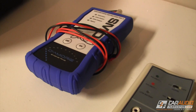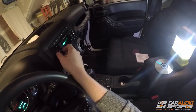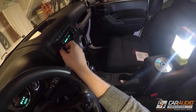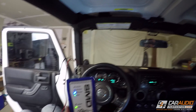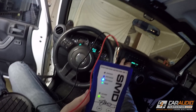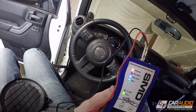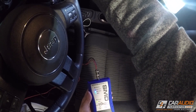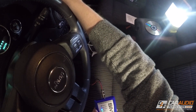The next thing that I usually test is at what point the head unit creates distortion. For this task I'm using an SMD DD1. This device is purpose-built for detecting distortion and later in the process I'll be able to use it for setting my amplifier gains. But for now I can determine at what value the head unit distorts. The way this works is you play a 1000 Hz tone and a 40 Hz tone and see at what value the DD1 detects distortion. I record this value because I want to make sure that later in the process I set the gains on the amplifier while the head unit is set to this value for maximum undistorted output.